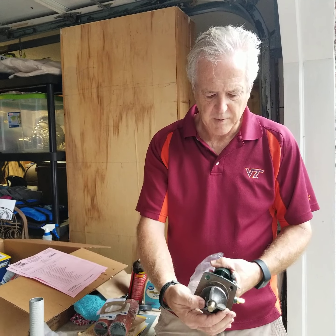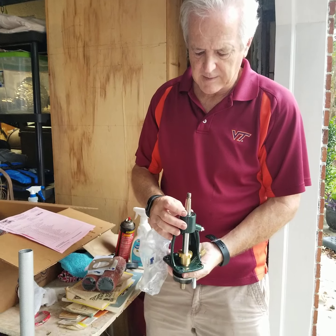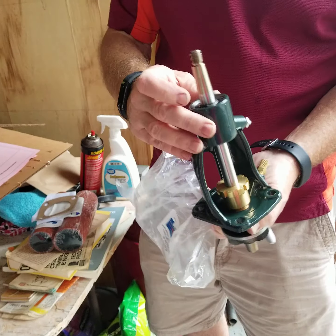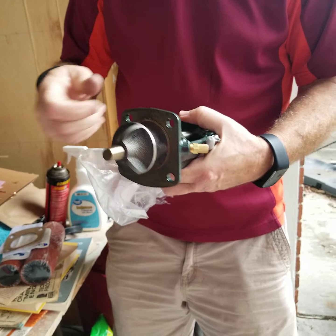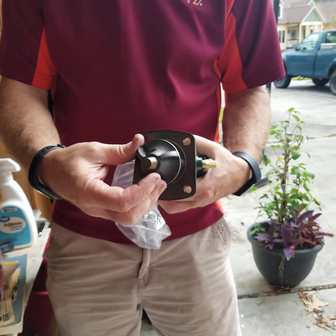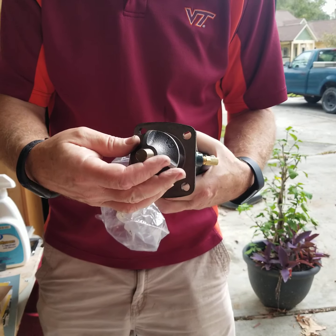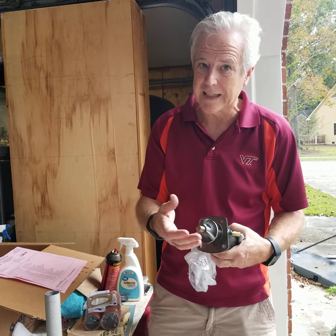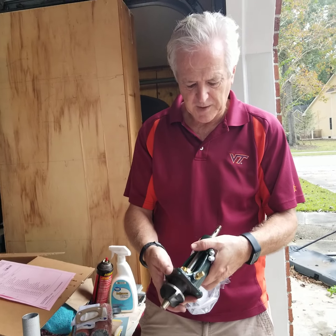So this will turn, so the pulley will go in the front of this. The difference here, of course, on the front, is it actually has a ball bearing, which probably they did not have in the original ones. Leakless, so this is designed to fit up into the engine and turn. As it turns, it pumps the water. And so the idea that it's leakless, as you can imagine, implies that the original ones just were designed to leak. Not a good design. But many advances, of course, have been made over the years.